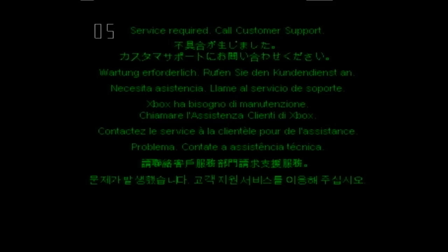The Aladdin XT series, by default with a quick press, will boot with the chip disabled — i.e. if you reboot the machine it's going to be disabled. The chip will only boot enabled if you long-press the power button. So a quick tap boots by default with chip disabled. Error 05 means the disc is not locked. The disc has to be locked for retail BIOS dashboards to load — it's to protect the files that Microsoft put there for the dashboard to make sure they're not tampered with. So if your hard disk drive is unlocked, which it will be by default now, we need to relock it before anything else will work.